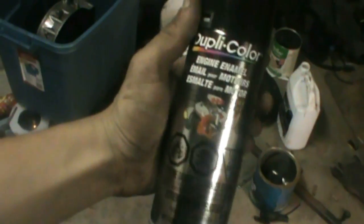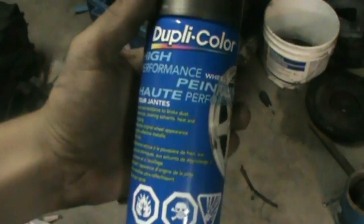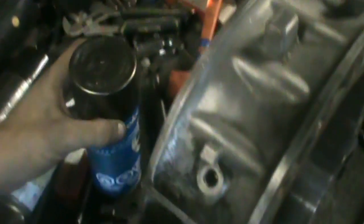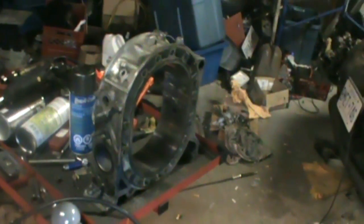You've seen this one a while ago — that's my intermediate iron. Got the rear iron all ported here too, so that one's pretty decent. Right now that's the front iron right there, it's all ported too. So pretty much all my porting is done — I'm just getting them all clean, giving them a final clean, and I'm gonna paint them all here. I got high heat gloss black for the irons, and I like to use high performance graphite tire paint for the rotor housing. Just getting them cleaned right now, and I'll go over all the exhaust ports in more detail and show you how I did those.